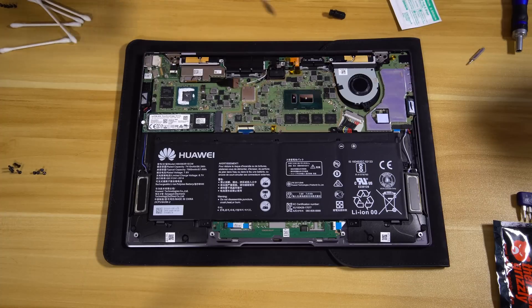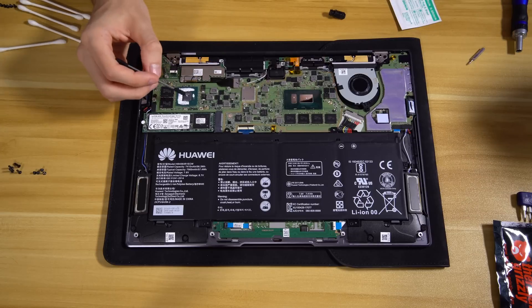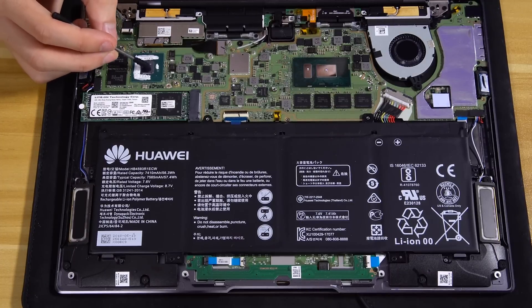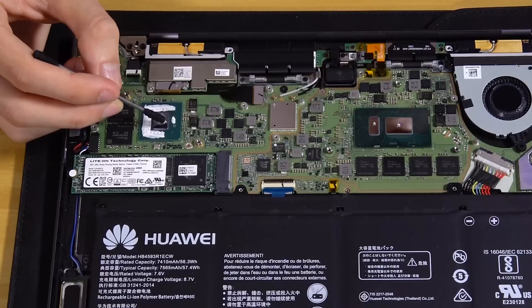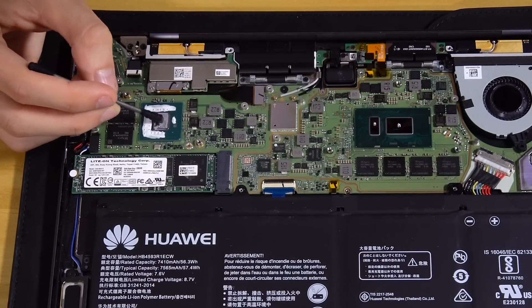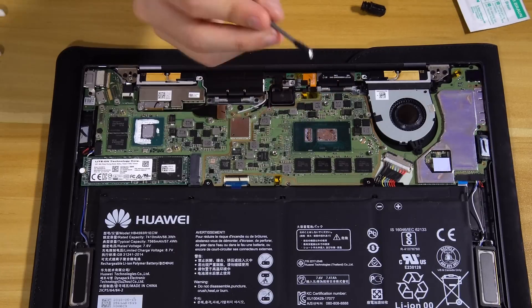Once you've added a small bead-sized amount to each die, take one of these finer Q-tips to spread it around. It'll behave very oddly — you have to give it some force to break through that thin upper film, then it should spread fairly evenly. I'll start with the GPU: it's going to be a little stubborn at first, wanting to stay in one or two big clumps, so just keep working with it. Be very careful not to push it over the edge. Now moving on to the CPU — see it spreading very nicely.